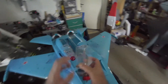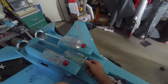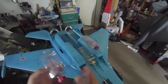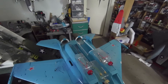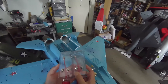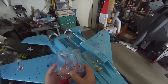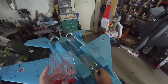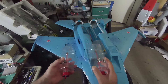I have two tanks, 500ml each, or one 700ml tank. Usually two tanks will give more time. This turbine consumes 150 grams per minute of fuel. 150 grams are about 180 milliliters. So if I have one liter, I'll probably be able to fly four minutes. If I add a third tank I will have 1.7 liters, so I'll be able to fly around eight to ten minutes — let's say seven minutes with a margin for landing time.